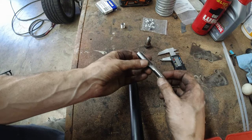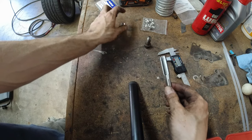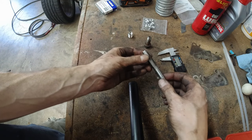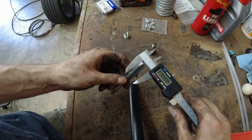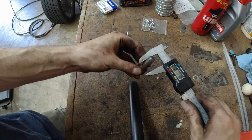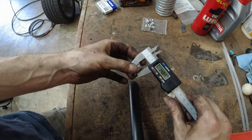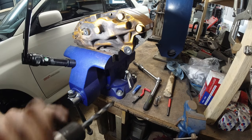I was going to test it out on something else — drill a hole, tap it and test the helicoil — but I'm 100% positive this is going to work. I should have been measuring all this in millimeters, not inches. So in millimeters: tap is 14, bolt is 11.8, helicoil outside is probably 14. This is the front caliper.